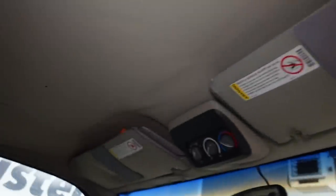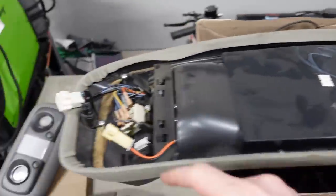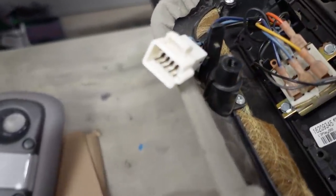Now it's time to move on to the overhead console. GM put these mostly in Tahoes and Suburbans - as far as I'm aware they never put them into an extended cab or regular cab truck, but it's really easy to add them. I did that on my last 96 as well when I did the Suburban front seats. Extended cabs you can add them really easily because there are two little square notches cut into the roof kind of underneath the headliner that the rear tabs of the overhead console grab into to hold it up. In the front there's just a single hole that you need a screw and a clip to attach to.